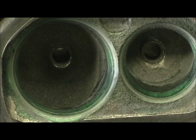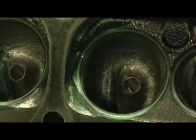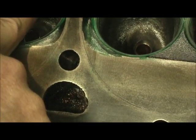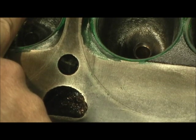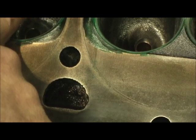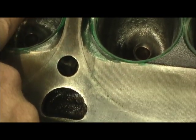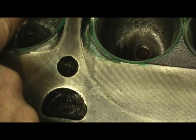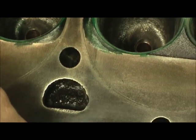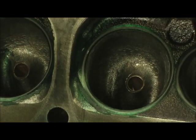I'm going to go ahead and cut all this out and take some photos as I go. As you can see, the line was drawn and brought up to the 60-degree angle before it rolls into the seat — you can still see some telltale signs of the line. The bowl was then ground all the way with a 9/16 egg, shaping it right up into the 60-degree turn. On the exhaust side it's much less, because on the exhaust we need to get more out and the seat width is greater — that's what she looks like.